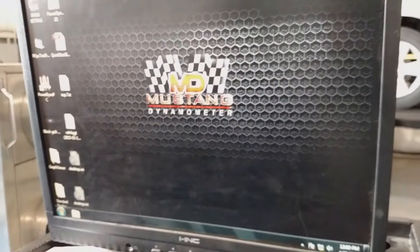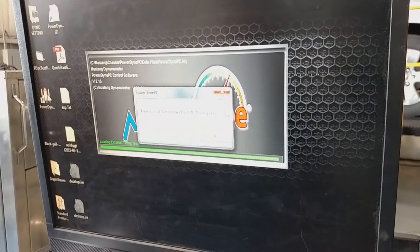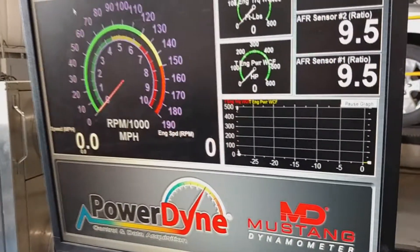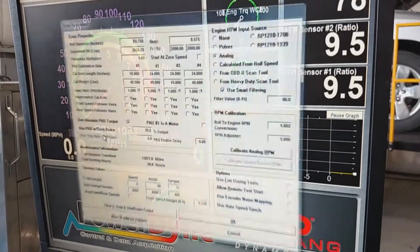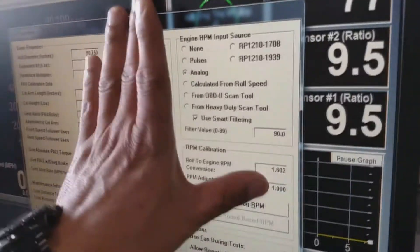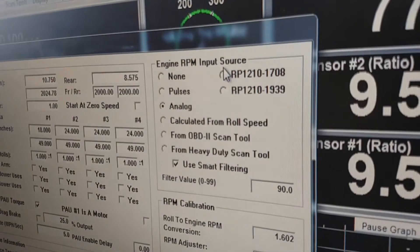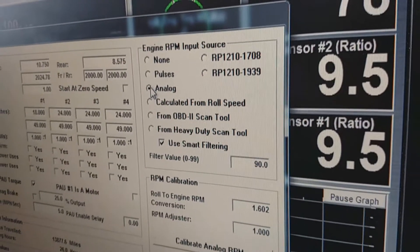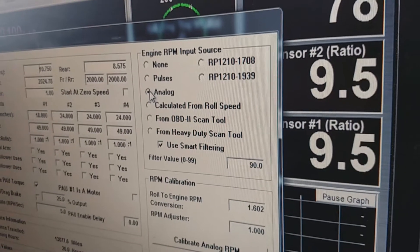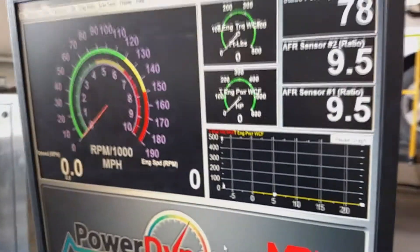After you see the COM port, exit out of there and open up your software — double-click on the SpeedShooter icon. Say yes to let it in. The first thing you need to do is go to Calibration > Dyno Parameters. Since you're using a SmartTach, don't change anything on those parameters. All you need to worry about is the input for your RPM source — TS1 or Inductive — they're both 0 to 5 volt analog, so put Analog there and hit OK.